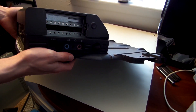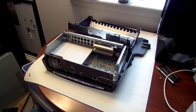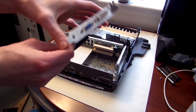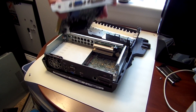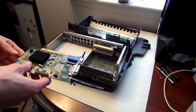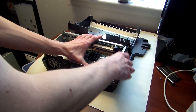What's really cool is that it has expansion card slots, and these are all PCI slots. What I'd like to do, because this is the way I remember it being configured, is install this — it's a Matrox Millennium G450, dual head, basically with two outputs on it. Although I'm only going to use VGA, it's still nice to have because it's a 32 meg card, and the laptop only has 8 megs on board of video RAM.